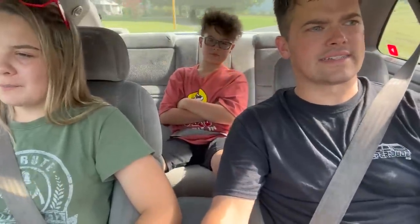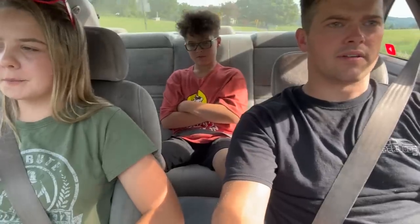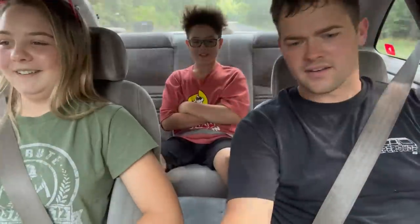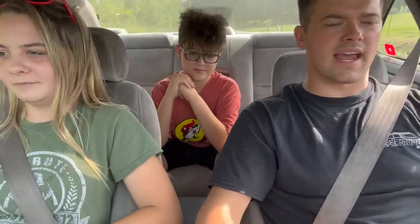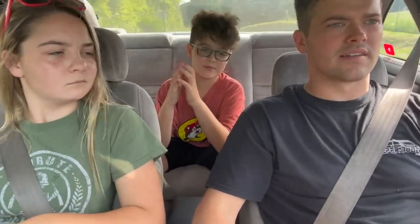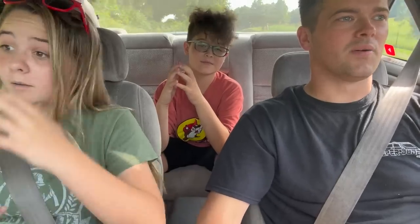Compared to the supercharger and the stock heads and cam, it was more punchy down low. This thing wants to be revved. Right, let's punch it at 3,000 here. It broke up there. Didn't like that. It went lean. It went red. I wish we would have had our data logging because we definitely ran into a limit there on something. It went all the way to 15 pounds of boost. It went to 15 pounds? Yeah. Okay, no wonder. Probably don't need to do that again.